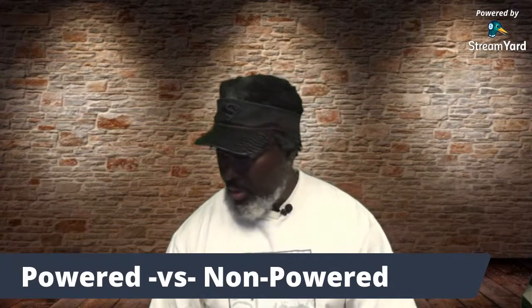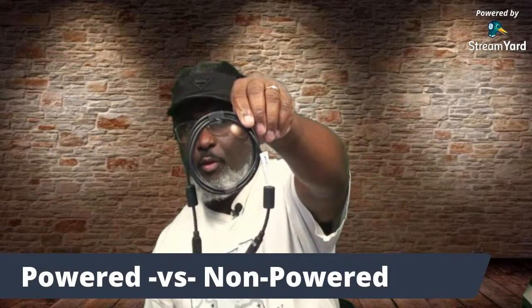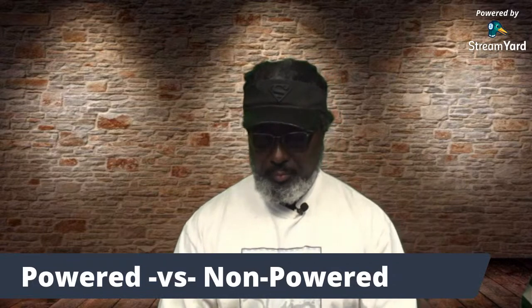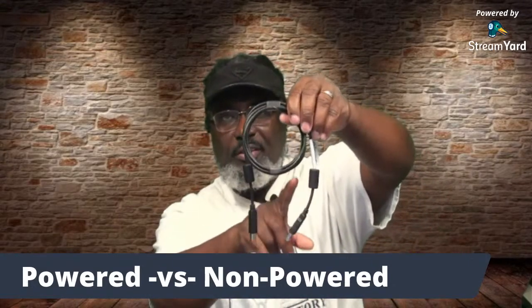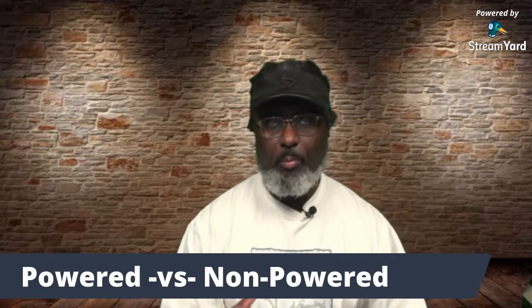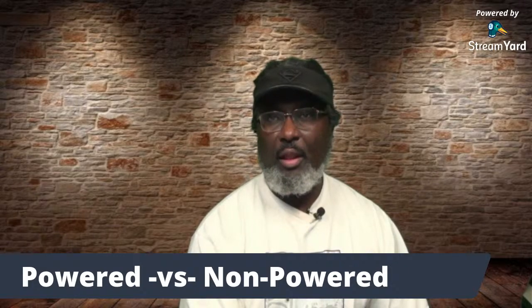All right. I'm going to mention this real quick, but I'm going to post it as well. These are the USB cables that you should be using. And if you can see what the difference is, this one is a cable that I use for a controller. I used it for the NS7, but I'm probably going to use it here now since I'm not using the NS7. The reason why is these little black things right here. Some of them may not have two, one on each end, but if you've got them on both ends, that's a good cable to have. What that does is filter the frequencies from the power cable, or from anything close by that produces an RF frequency, from interfering in it.